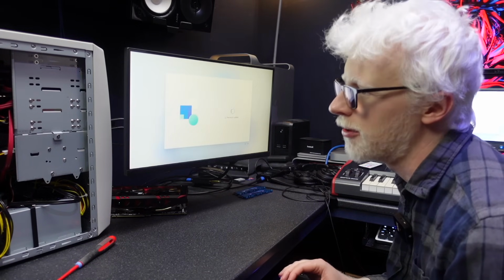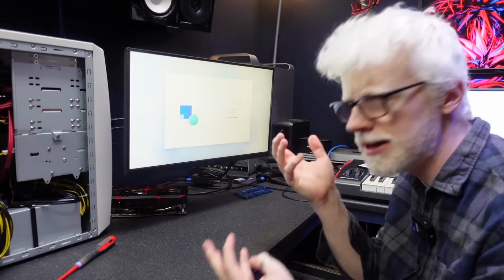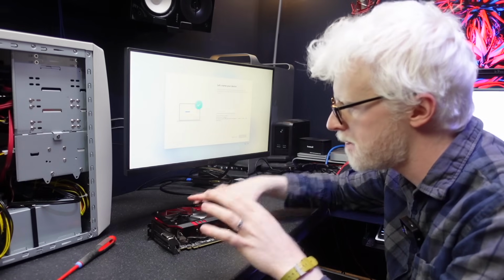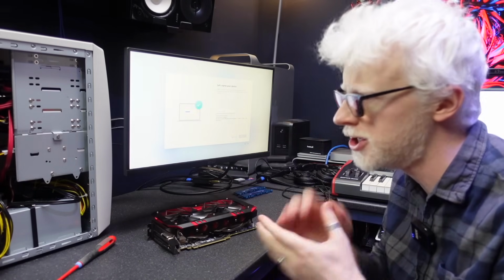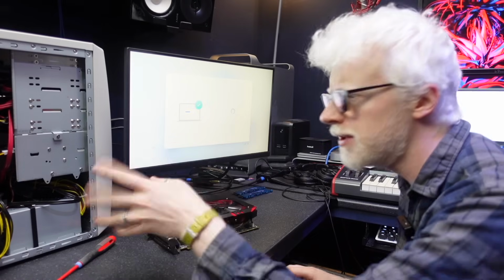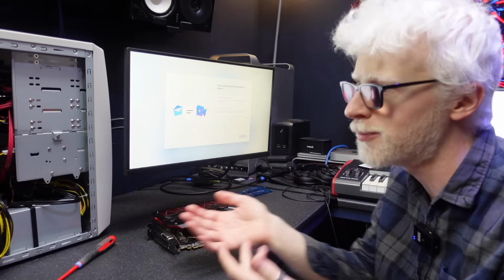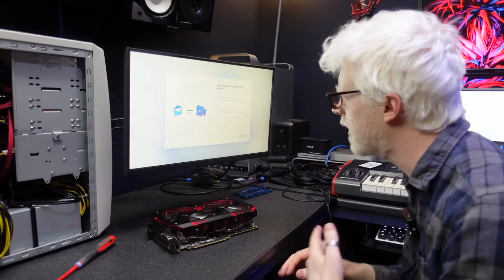That's another thing, you know, we're not looking at consumption of power as much, we're looking at the stability of power. So maybe this GPU isn't actually faulty as such, maybe it's just slightly more sensitive to those fluctuations in power between the two supplies, because as I've previously stated many times, it's not exclusively powered by the GPU PSU that I've got in this system, because it's drawing up to 75 watts from the slot on the motherboard, which is obviously powered by the other power supply.